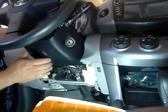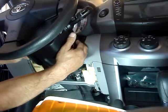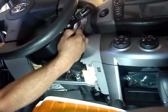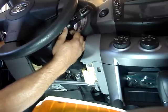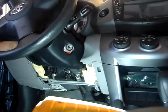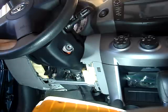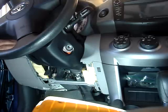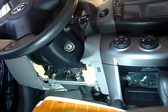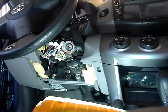We're going to pop the steering column. Apply a little pressure on the sides, then up at the keyhole. Use a back-and-forth action — you should be able to get it to pop. If it's stubborn, you can use a plastic tool with a little pressure on it and she should release right off. Then drop the bottom out to get to the ignition plug.